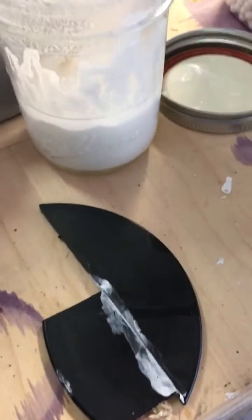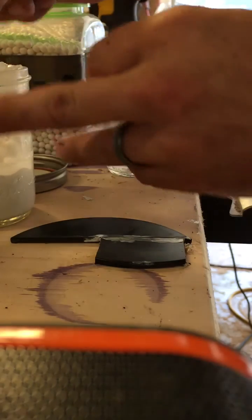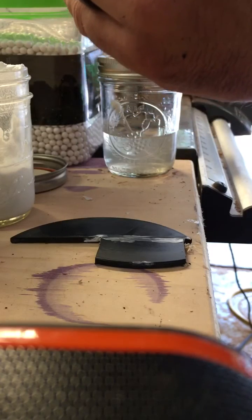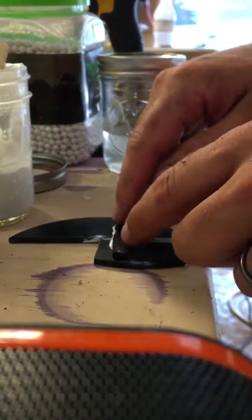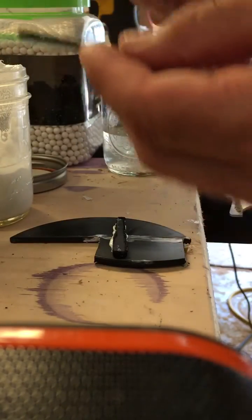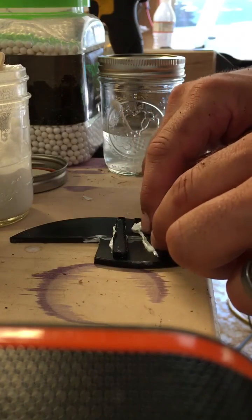In fact we can do that real quick — let me cut off some pieces. We've got some stitches cut here. You could do this if you're repairing a dashboard on an old car: put these underneath along with your stitch weld from the Dremel tool, then lay these across that weld glued down with the ABS paste, and it would probably make it stronger than the surrounding dashboard material. It may crack again eventually, but at least it's taken care of for now.